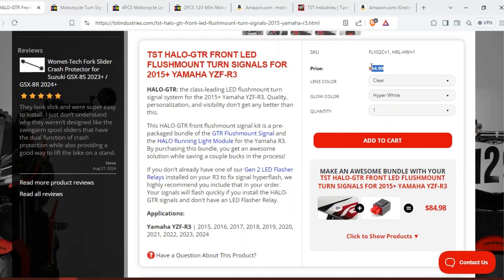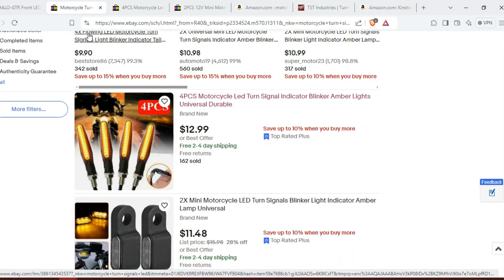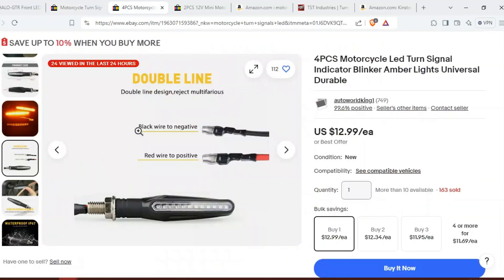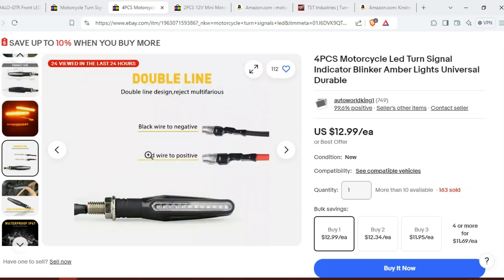However, at $65 plus everything else, this ends up being almost a hundred dollars for these turn signals. So if we want to go for the cheaper option and type into eBay or Amazon 'motorcycle LED turn signals,' we'll find something more like this — $12.99 for four. That's a lot more affordable. These are two-wire connections, but our motorcycle wiring harness has three wires. A lot of people will just get rid of the constant 12-volt wire that works as the running light, and they'll just connect the ground and the intermittent signal from the turn signal — and so they get rid of their daytime running light feature.